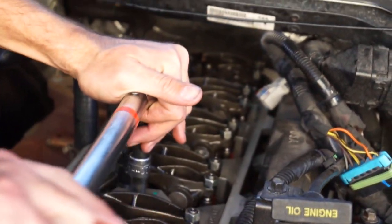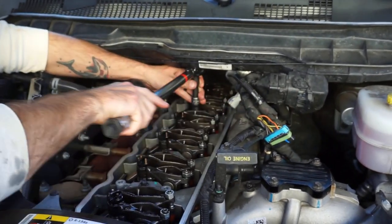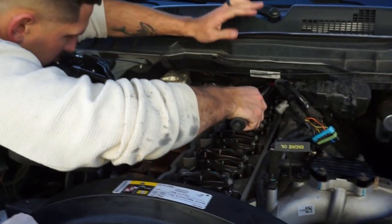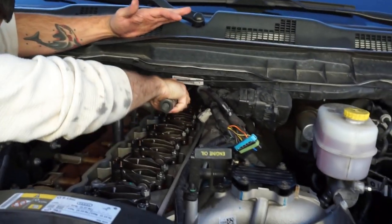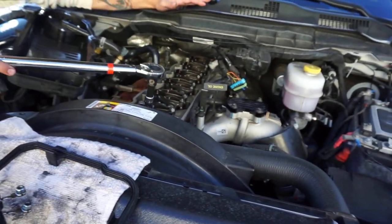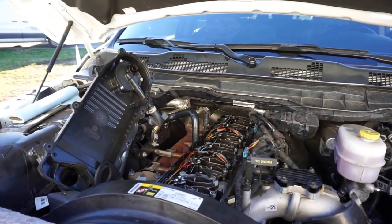The rocker box is on right now. The shave job on the rocker box went well because it sat flush. Ryan is torquing from the middle outwards — 18 foot-pounds for the rocker box. Personally I always start in the middle and work outward, because you're torquing a flat plane surface and you want torque evenly dispersed across the whole plane. That way you don't end up with a gasket leak. After that, reinstall the injector harness — just tighten until a sharp rise of torque and that's it, nothing more.